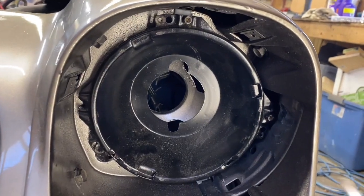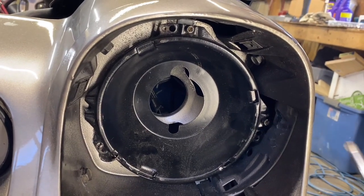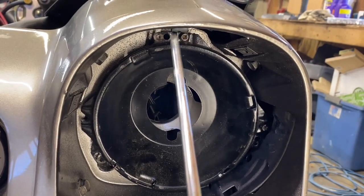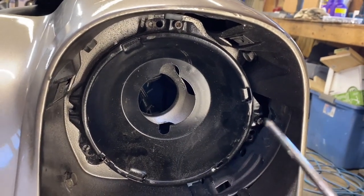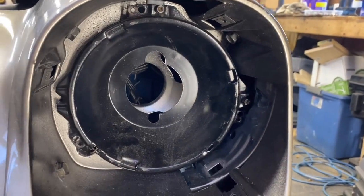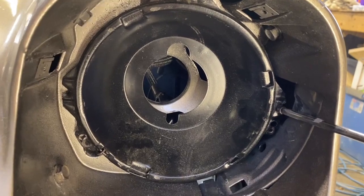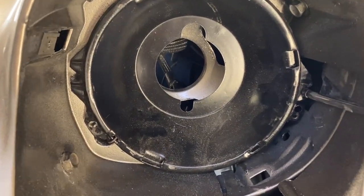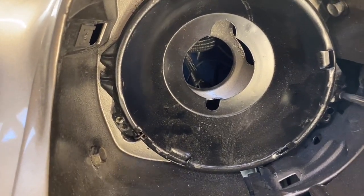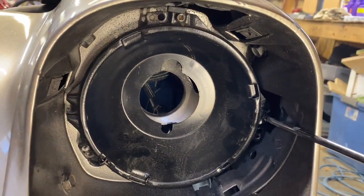What the spring tension does is allow you to move the lights back and forth. When you screw the side adjuster in, it's going to adjust the light this way. When you screw the top adjuster in, it moves the light up; unscrew it and it moves down. If you just watch while I spin it, it's subtle but the light is actually turning and going straight.